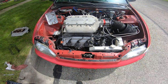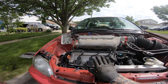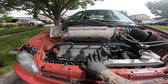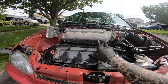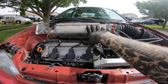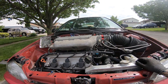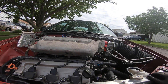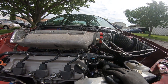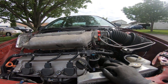Alright guys, she's all back together now, everything is ready to go and about ready to start it up. For those of you wondering, this motor is a J30A4 out of a 2004 Accord V6. The spacer and intake manifold are off of a 2005 Pilot, which I believe is the J35A6. So if you guys are wondering what manifold works with the Accord motors, I would definitely recommend this one. Everything on the throttle body lined right back up perfectly and it was a pretty clean and simple swap. I'm going to get some of these connectors connected back up and then go ahead and fire her up and see how she does.